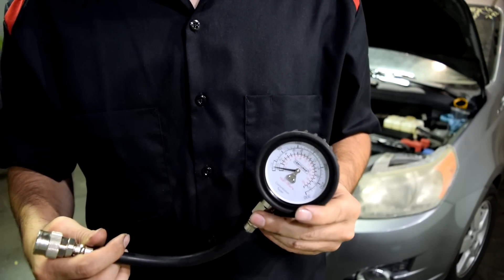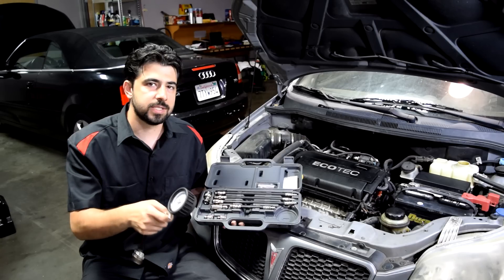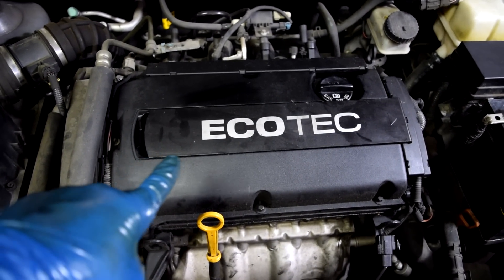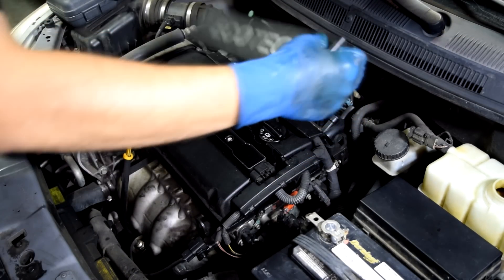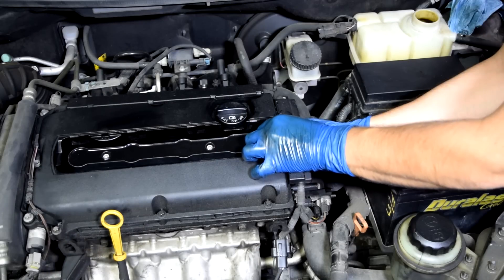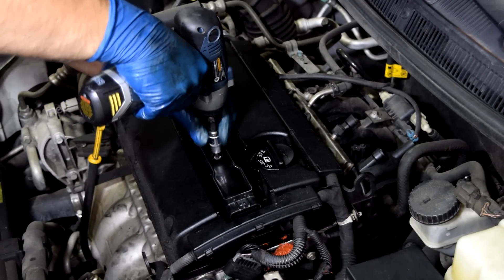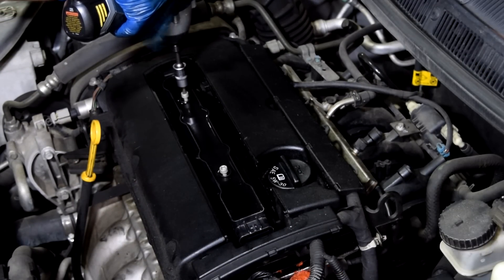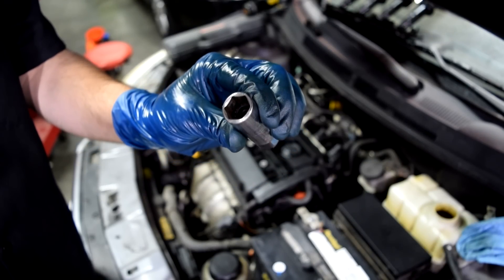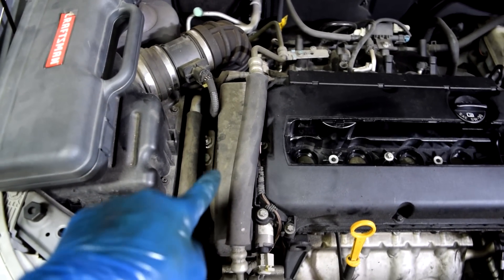What I'm going to do next is a compression test on all the cylinders on this engine. You obviously need a compression tester kit — I'll put a link to a good set in the description box. To do the compression test, we need to remove all of our spark plugs. We'll start by removing this cover, then remove the ignition coils. Since we need to disable the ignition system, we'll first remove this connector, then these two bolts requiring a T40 Torx socket. Then with some wiggling this should come up. We'll grab our 5/8ths spark plug socket and remove all spark plugs, starting with spark plug number one, which is usually the one closest to your timing belt or timing chain.